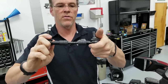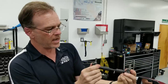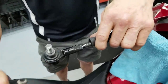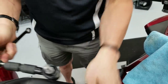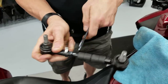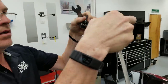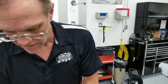So the second rod — you want to kind of line it up with the first, then use two wrenches, one on the wrench flats. You can use that 14 millimeter — we supply you with it. Tighten the second one. When you finish, when you rock it, it should basically be working as a flat, parallel unit there. That's all there is to that.